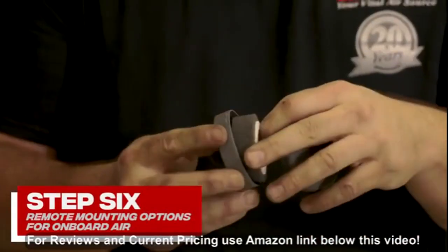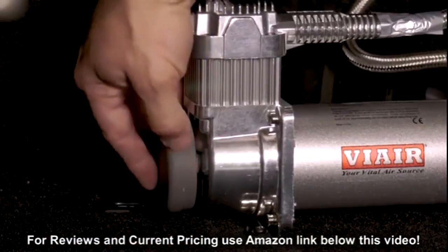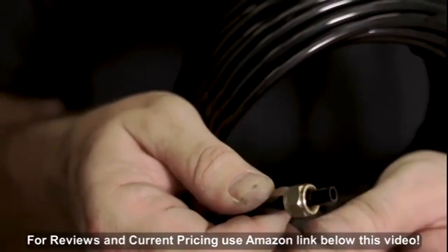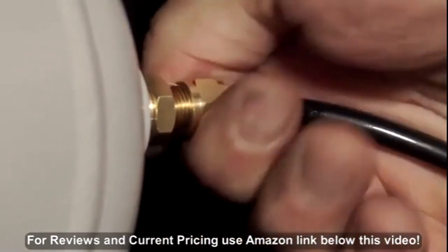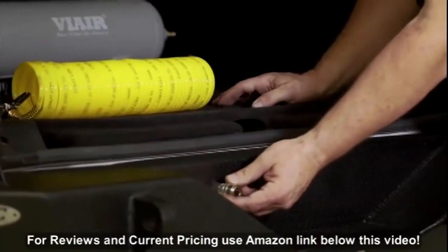This will enable you to mount the air filter remotely, away from the air compressor where it's nice and dry. This is the element that goes inside the upper body that screws onto the back of the compressor — if you're using your compressor very often, check it every month. To mount the air chuck externally on the outside of the vehicle, make sure you insert the line on the fitting and make sure it goes over the barb. You can drill a hole in your bumper and mount the air chuck right there.